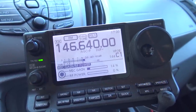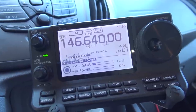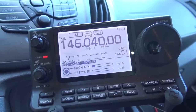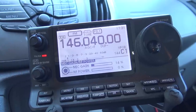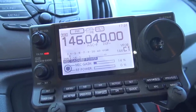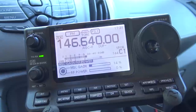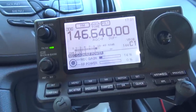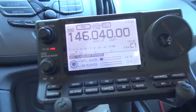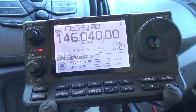That is zero percent of my power meter — KJ4YZI. There's no difference through the repeater. I'm just amazed that at zero percent I'm still putting out something — maybe just the driver on the radio. This little antenna, about seven inches tall on a magnet mount, about five or six miles from the repeater, is doing quite well. The other operator reports it sounds like I'm sitting next door regardless of the power level changes.